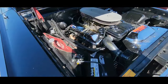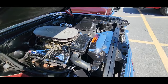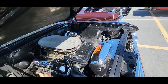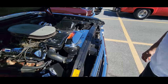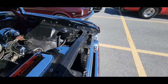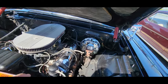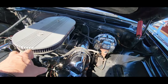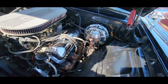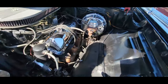All right. So your starter relay, right? Yes. Is this your starter relay? You got your front distributor set up on it. Points. Yeah, for the younger generation, they're clueless what all this stuff is. Exactly. But back in the day, you and I were replacing the spark plugs. We come over here, you take the distributor cap off, put a new rotor and cap on it. Then you may have to adjust the distributor a little, with your little gun that would flash for the timing, you know what I mean? And then if you did your brakes, you had to figure out how to bleed the brakes. And then, oh, here's your fuel pump.